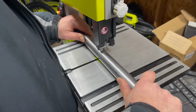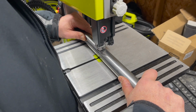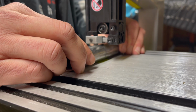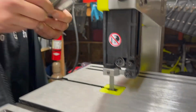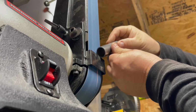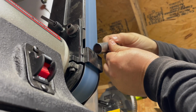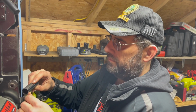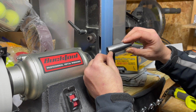But I'm 6'3". Your standard drift trike frame is not going to be comfortable for me. We're going to lengthen the frame by a solid 8 inches. And that means inserting more pipe into the length of the frame. Inserting 8 inches of pipe. I feel like there's a joke in there somewhere.